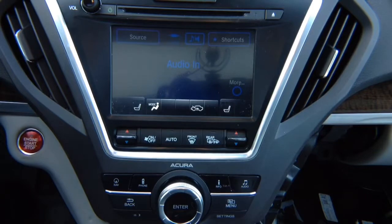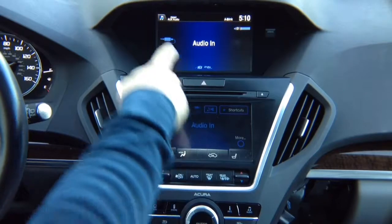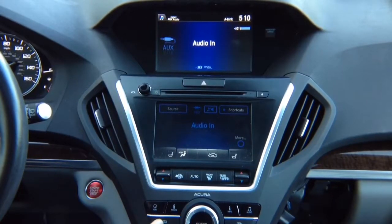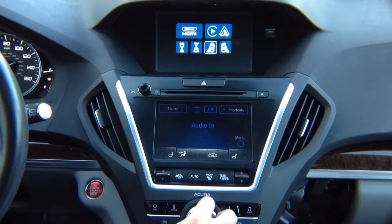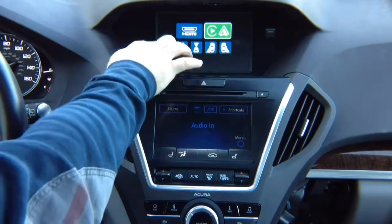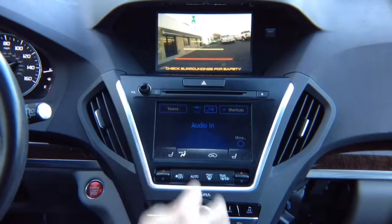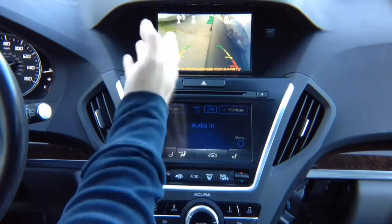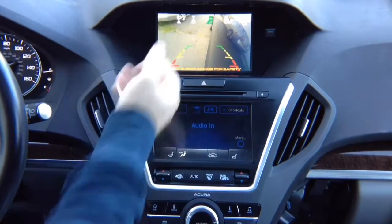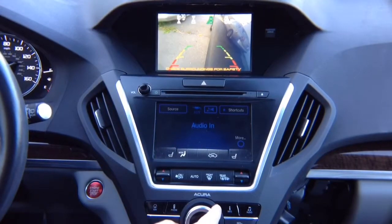Now that we installed everything, we want to make sure everything works. Set the radio to auxiliary. Press and hold the back button. The interface will activate. With the joystick, you can select all your options. So, let's see what we got here. The rear camera is factory, so we cannot select it, obviously. Front camera, left camera. You can buy one with lines or without lines. It is not adjusted, it's just to show you can have a left camera, and it's going to work automatically with turn signals. If you don't install the left camera, it's okay.